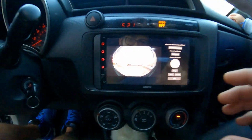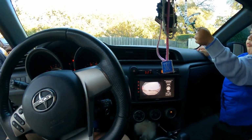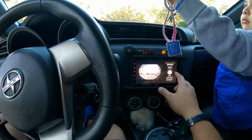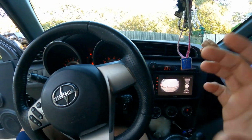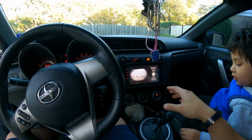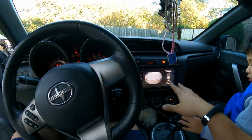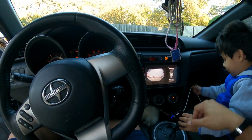So this right here, this is your calibration for your car. So you're gonna put the dimensions of your car, how big it is, but basically you're gonna use this to move the camera and make sure that it's centered on the lines. Now, you do get the instructions with the kit, so it just takes a few minutes. It's not too hard. You just lay this out, make sure there's no wind, and calibrate it. And then at that moment in time, it'll be all done.